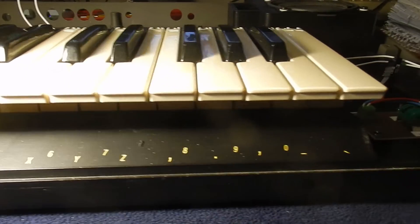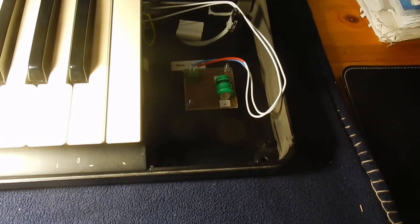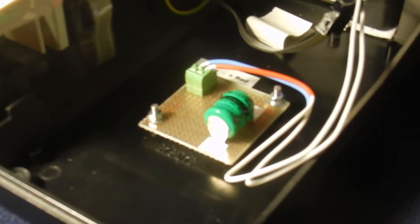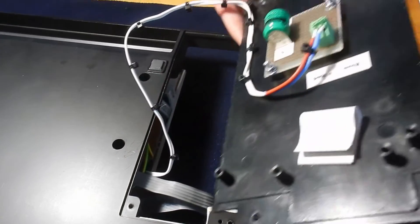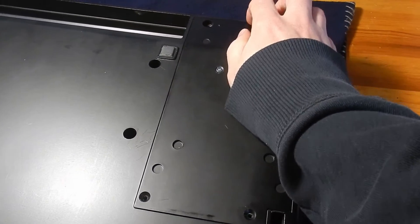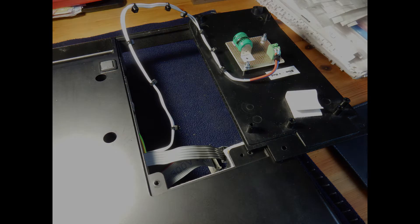Now it's time for the big fix. The new battery is on its own little daughterboard, mounted behind an easy-access panel in the place where otherwise the video card option would be mounted. Yes — there actually exists a video card for the WX2. It's got a pretty basic graphics chip, but it outputs RGB or composite video. Believe it or not, the optional video card actually has its own Motorola 68302 CPU on it.